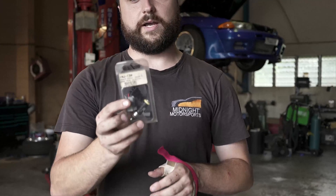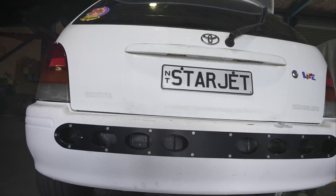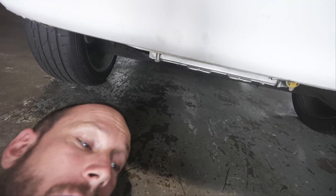The car drove really good - very happy with it. We're going to do a little bit of road tuning. The next thing we need to do is swap out to Bosch 2200cc injectors since we've got 1250s in at the moment. That should be a pretty mean fuel setup and we don't think we'll be running out of fuel anytime soon.